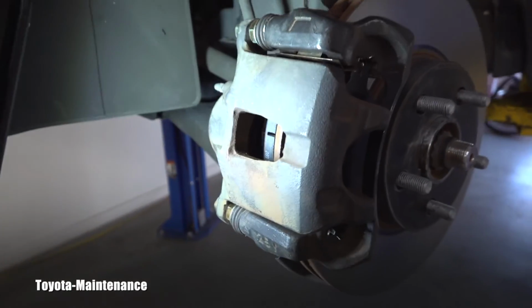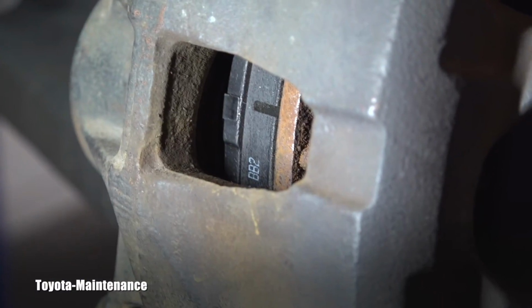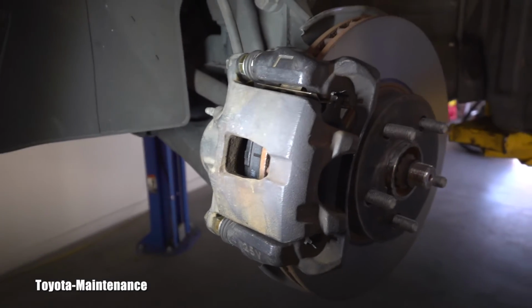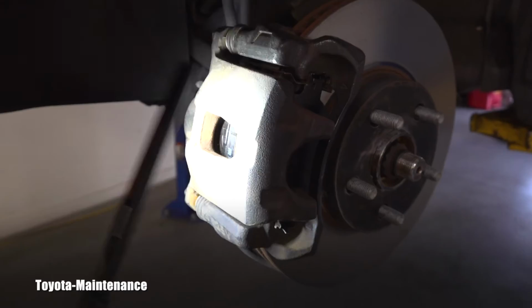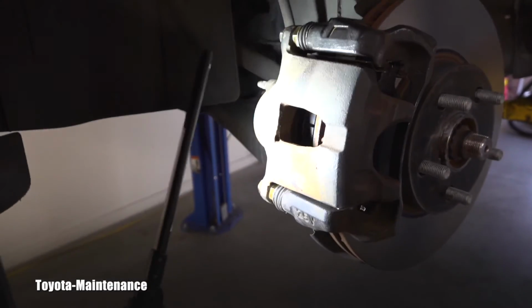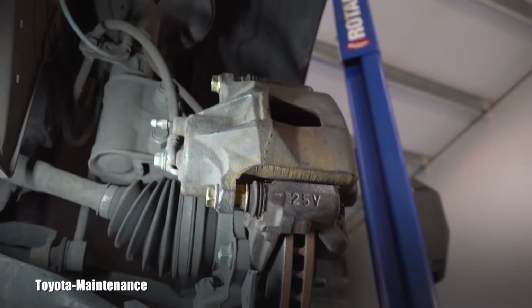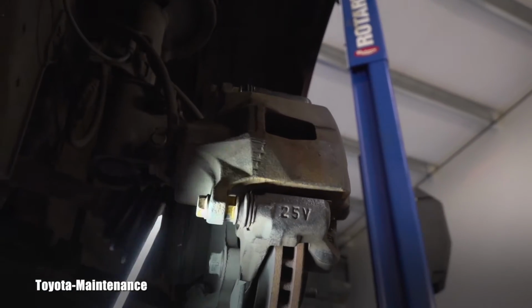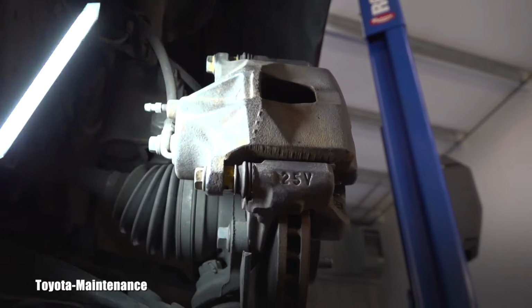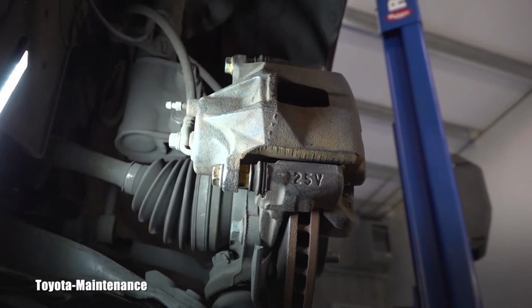So you can see here, for example, that new brake pad lining, right? It was done today. You can see how large this caliper is. And you can also see here in the back, basically it's only a one piston brake assembly. You can see here the sliding pins. That's the bottom one. There is a top one, right? That always needs to be lubricated here inside.